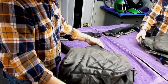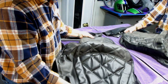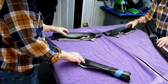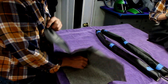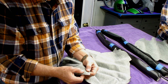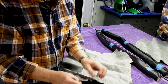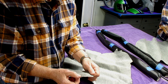I wanted to show this seat cover I got from Ray Straub — it looks like it's for a touring bike. I saved it thinking I could cut a piece out of it. Now, about vinyl: vinyl can be non-stretch — usually there's no fabric backing, it's just plain vinyl. When it has fabric in the back it means you can usually stretch it a certain amount. You can heat it with a hair dryer and really stretch it, or use a heat gun. Before you work on a seat, get a feel for how hot you can make it — if you get it even a little too hot, you destroy the vinyl.